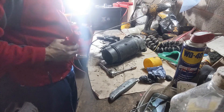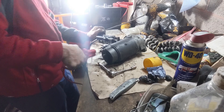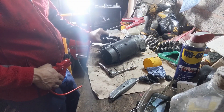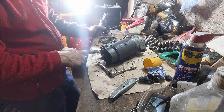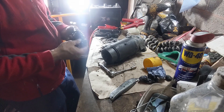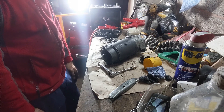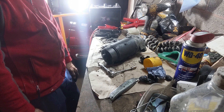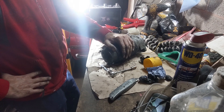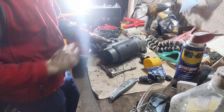I'm not sure if I've done something wrong again — this is where the power normally gets connected, and if I just connect power to it now, it starts spinning straight away, which I'm pretty confident is not what I want. I'm wondering if the plastic cover was insulating it in some way on the old ones. Either way, I'm dead pleased the starter motor works, because I can get a new solenoid for about 50 quid as opposed to 270 for the whole unit.